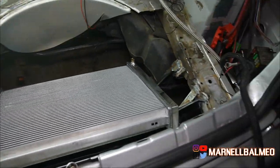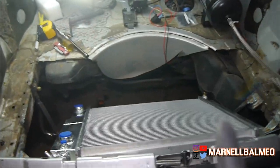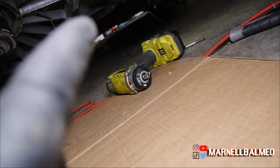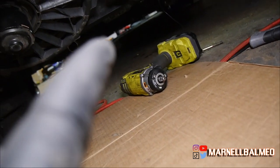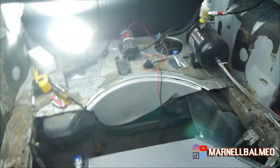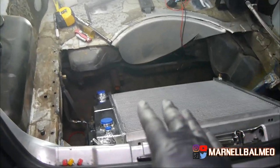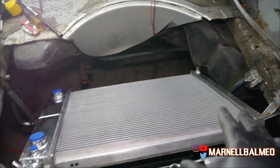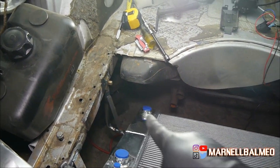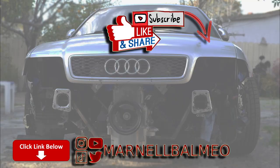Alright guys, the mounts are good, the radiator is installed — it's pretty solid, which is good. It is a little bit low in this area, but right in the back that's my diff mount, so if I bottom out there I'll hit this fan, and if I'm bottoming out there I have a bigger problem to begin with. I feel like this is going to be a good setup. Next up I'm going to mount my electric water pump in this area, but for this episode this is it guys — thank you for watching, I'll see you next time.